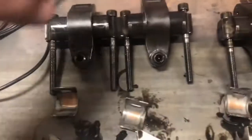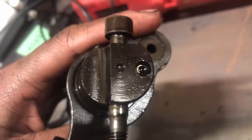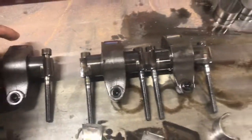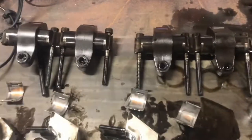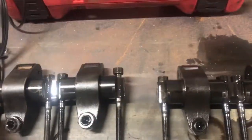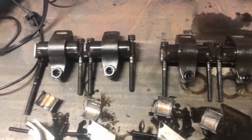And then the last issue, which this one actually doesn't have, is you have oil galleries drilled through there, which you get pressurized oil in that hole there. So both assemblies have those. Those plugs will get blown out. So there's videos online of people cutting the bolts to ram in there and stake them in. All four of my caps are still in there, so I'm just gonna stake them in and figure it's good till the next timing belt change.